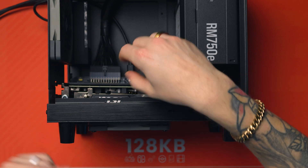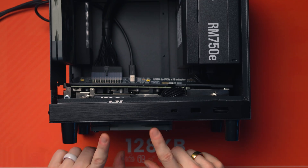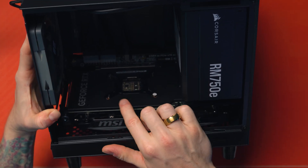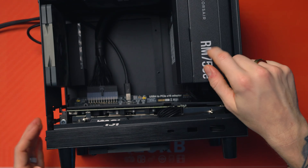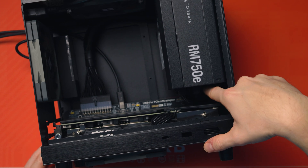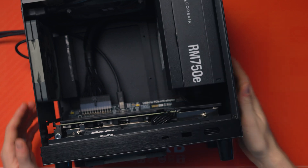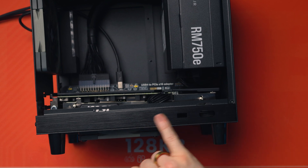The bottom fan pushes air in, which gets pulled in by the GPU and then exhausted out from the top and back. I really wanted two fans on the bottom inside, but with the way the graphics card sits it just wasn't possible, and the power supply is modular so all my cables are in there — it's super tight. The cables from the power supply are touching the top of the graphics card, which I've routed around the back. I've also had to remove all the original I/O from the case to make it work, and pretty much had to completely dismantle the case to get everything in.